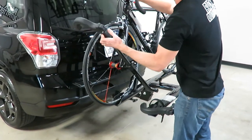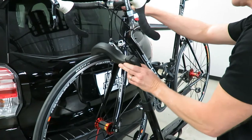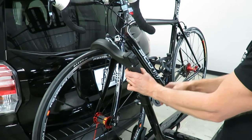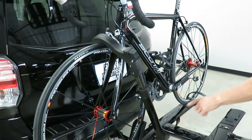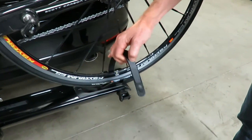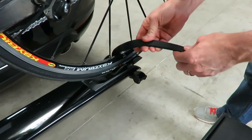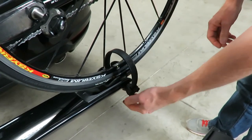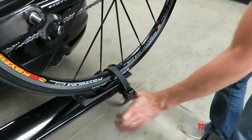There's a small divot at the top of the hook, and you want to align that divot with the tire. Get the hook in place as close to the first point of contact as you can without it actually making contact, then pull down as hard as you can to get a good firm grip. The rear wheel rests in a pivoting rear wheel cradle that automatically aligns with the position — all you have to do is run the strap through the buckle. The semi-rigid ratchet strap has rubber molded into the rigid plastic on the underside, providing protection to the rim. It's very generous in length to accommodate a wide range of tire sizes, and it's secured in place.